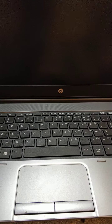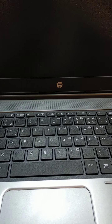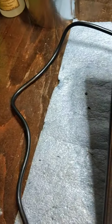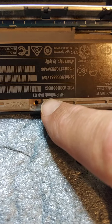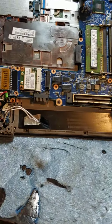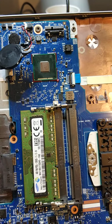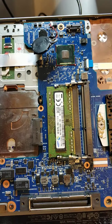I'm making a video about repairing this HP. It was very hard to repair. It's an HP ProBook 640 G1 that took some water. After repairing it, there were some capacitors beneath the chipset and some resistors eaten by oxides from the water damage.